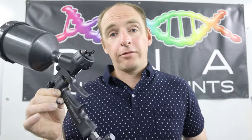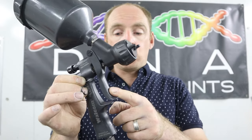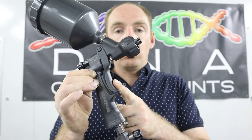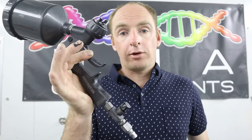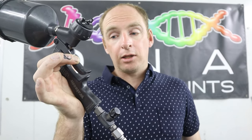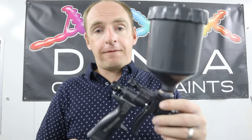Another thing is the operation of a spray gun — this is pretty basic but worth mentioning. The trigger on most spray guns is what they call dual action. The first little pull until it stops is just air coming out of the gun. The second part of the action is where paint comes out. So if you see me blowing air on the gun while tack ragging, that trigger is half pulled in — just be careful you're not pushing it further and getting paint out accidentally.